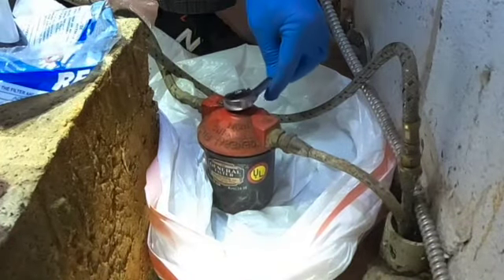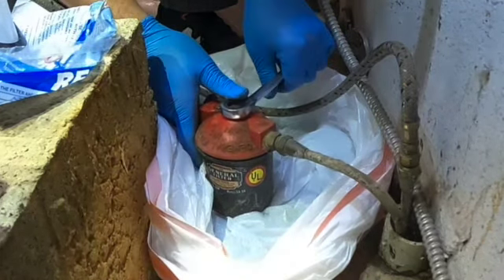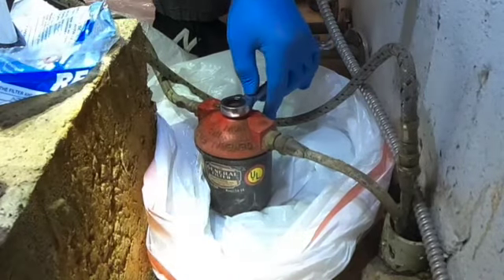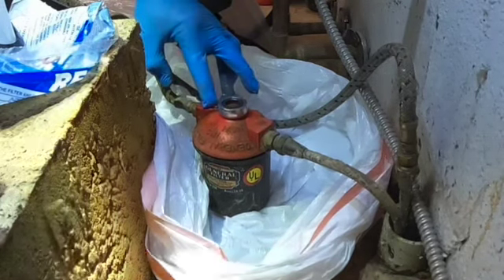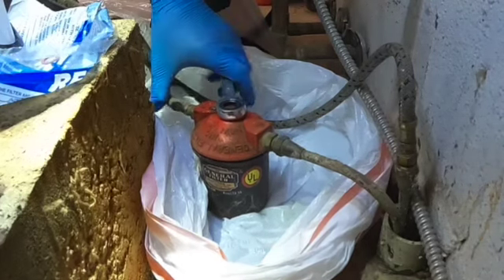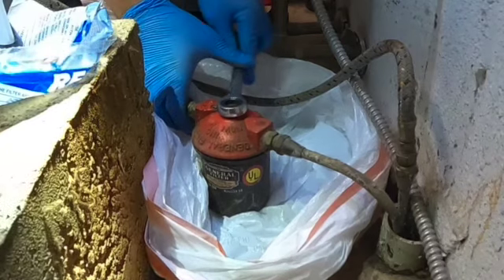If you get the wrench and try to put it on here with it way out here, you'll have to use two hands to tighten or loosen it and you're going to be fighting with it a lot. To make it easy, all you got to do is get it close to where the hose is at. Watch out for this little nut, make sure it ain't in the way — just enough so you can grab both sides and just squeeze here like that, and you can break it loose. Very simple.